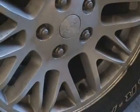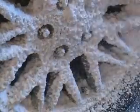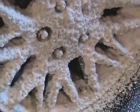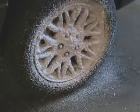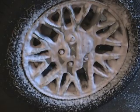In this application, a professional cleaner will be used, since this is a more difficult wheel to clean. It is applied dry to the wheel per manufacturer's recommendation. Allow the product to dwell for 30 to 45 seconds. This will be removed with a high-pressure cold water washer.